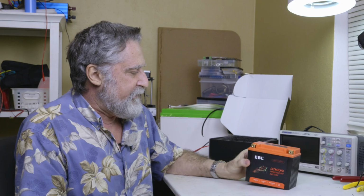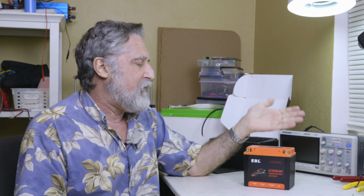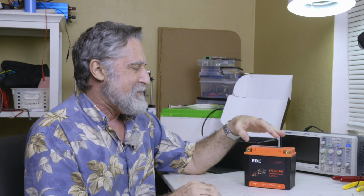So what I'm saying is, if you were to disconnect the battery or it disconnects itself while it's charging, the bike should survive it quite nicely, just like an outboard could survive it. The way I think of it is the engineers are probably thinking for both outboard motors and motorcycles, maybe these connections to the batteries aren't the greatest. And a lot of motorcycles, you can kickstart them, so maybe there isn't even a battery there. So they want to have their gear be able to survive that situation.